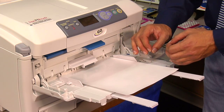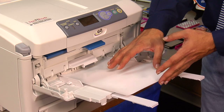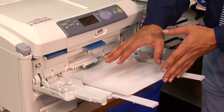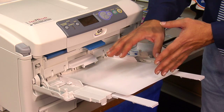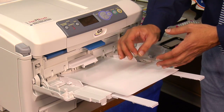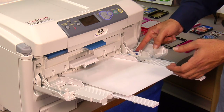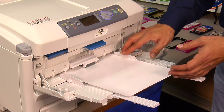The other trick I like to employ is instead of stacking 10 sheets inside of the tray, I like to hand feed the sheets from the Multi-Purpose Tray. The reason is that Image Clip Laser Light can develop a static charge. And if the paper has a static charge, the tray might try to grab more than one sheet at a time and feed it through the printer. If that happens, you'll definitely have a jam issue. So let's go ahead, elevate the tray and load it into position.